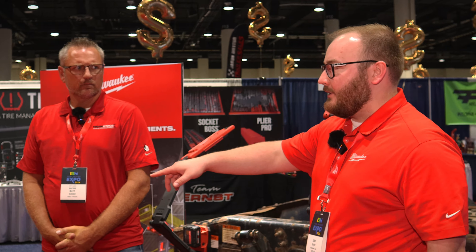Starting with the 3/16-inch — this is the more aggressive throw, giving you the confidence to remove that body filler. It features a variable speed trigger with a variable speed dial, and it's a palm-style grip so you're pulling from the top down to maneuver with the body panels and contour them. The biggest thing on this tool is the tool-free backing pad change. Previously you had to stick a wrench in — lose the wrench, risk breaking the tool. Milwaukee integrated that into the tool itself, so you push it down and remove the pad without sticking a wrench in at all.